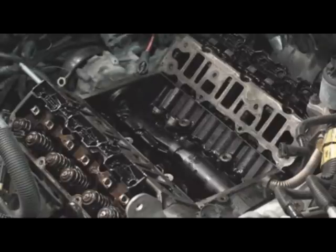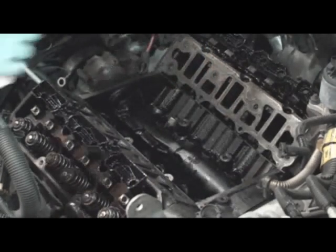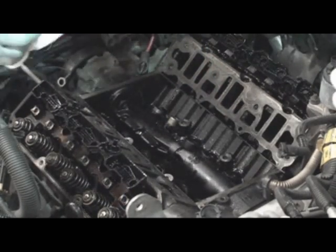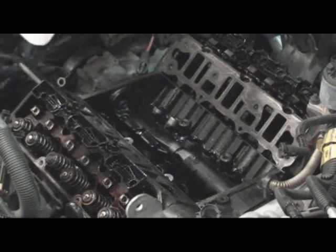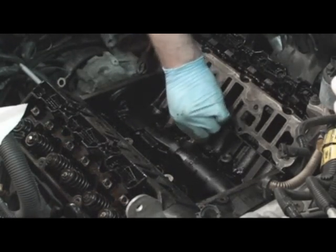It's because of where the cam is. That valve's pretty much open right now. So the cam actually pushes on the lifter? The cam rolls on the lifter, or the lifter rolls on the cam with the little wheel. And that's what makes these valve trains last.